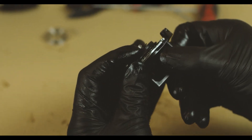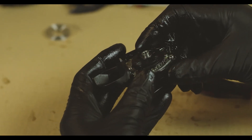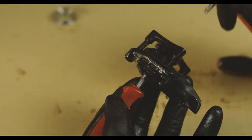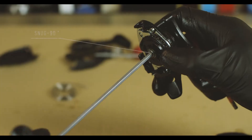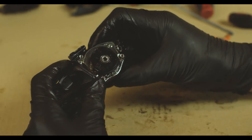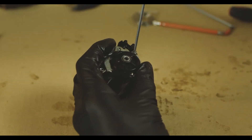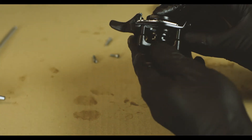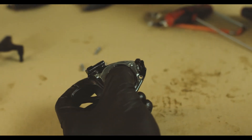Okay, that looks good — everything's stacked. Now we can thread this bolt back in. Take your four millimeter and your T25 and go ahead and thread. Now the pivot bolt is secure, so we can go ahead and remove the claw — that's the 2.5 millimeter Allen. When we pull this thing, we want to be careful not to let anything come apart.